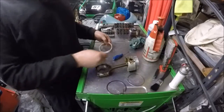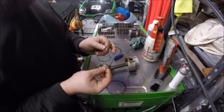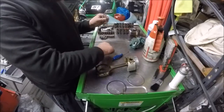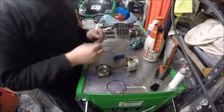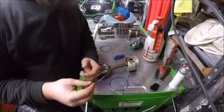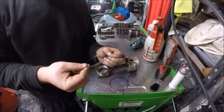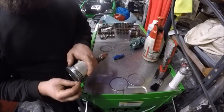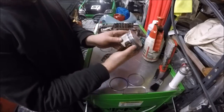And this one is your three-piece oil control ring. You have these two very thin rings — one goes on the bottom, then your corrugated one, and one goes on the top. These thin ones bend, which is not an issue. These tend to crack, so what we're going to do: these little thin ones don't have a top and a bottom, they're universal. Just drop that down into there, pull it round the edge — ping — in you go. You've got one ring in.